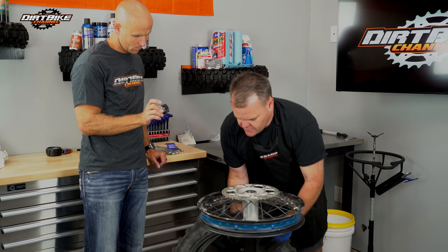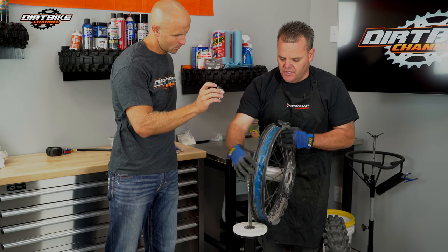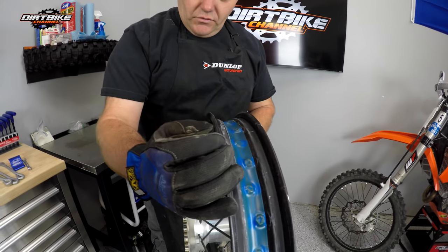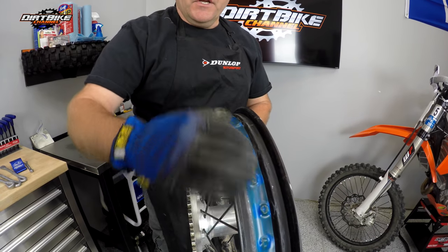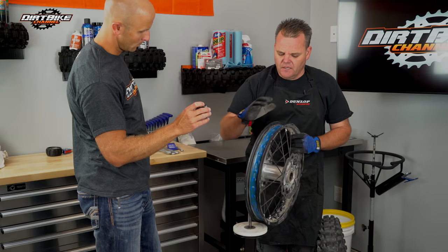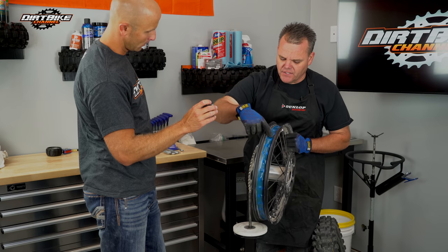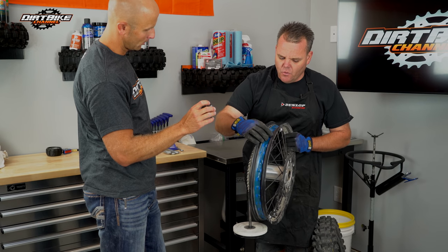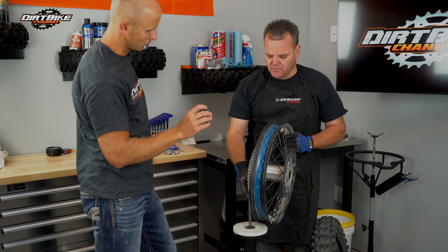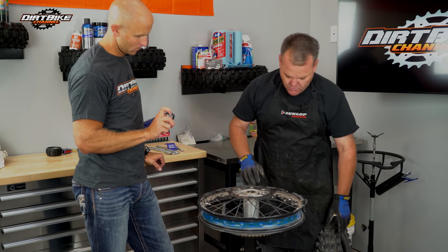I push the tire off completely. At this point, one of the first things I'll do is inspect the rim. This is a newer bike, so we're in good shape. But if you have a band that's torn away or broken, the spoke nipples will be exposed. You want to cover those back up with tape — we use Gorilla tape, works really good, or duct tape. You want the tape to stay right in the channel; don't let it go up onto the rim walls, or the tire won't be able to fit properly. Pretty simple, and this one's all in good shape — good time to inspect that.